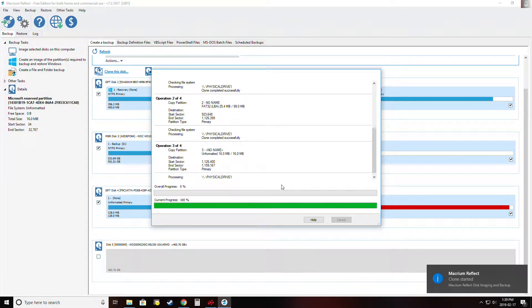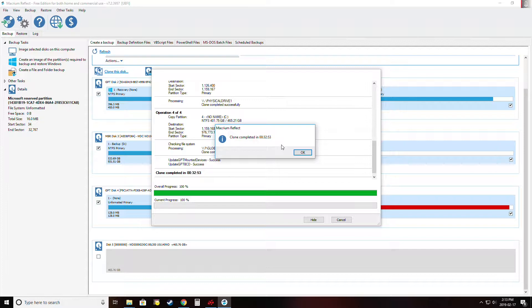Now it's cloning. This process can take quite a long time — from my understanding it can take literally hours. I'm going to end the video here and come back once it's done. We're all done with the cloning — it took 32 minutes and 53 seconds. In my case I'm using a SATA Samsung 850 Evo SSD as my old drive. If you're using an older mechanical hard drive this would take longer, and depending on drive size — I'm using 500 gigabytes — a terabyte drive could reasonably expect about double the time.